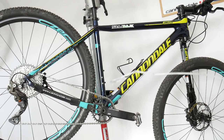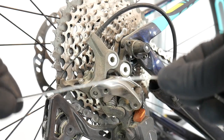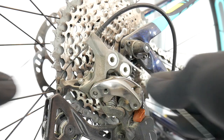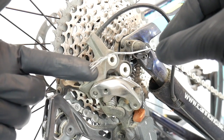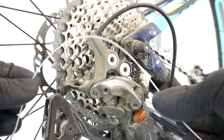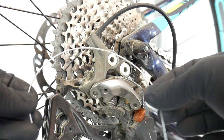The question is why some riders do snap cables. There are three situations basically. How to avoid snapping the cable — that's what I'm going to tell you within a couple of minutes. This is my rear mech cable, and 99.9% of cyclists use steel ones. These steel cables are made of smaller pieces as you can see, and they can take thousands and thousands of gear changes, thousands of kilometers on the bike, unless we get into one of three situations.